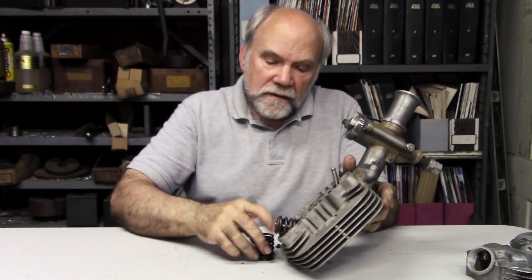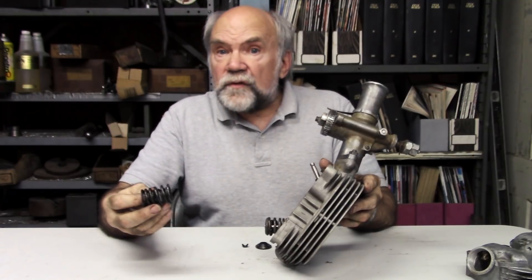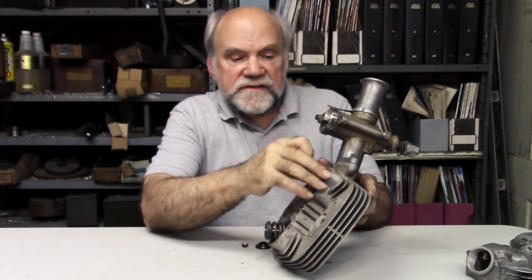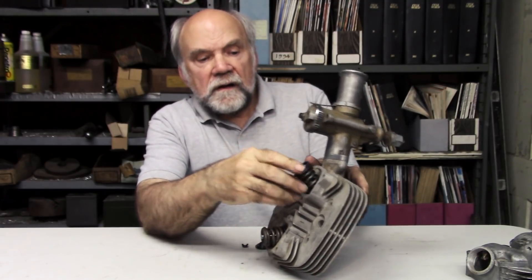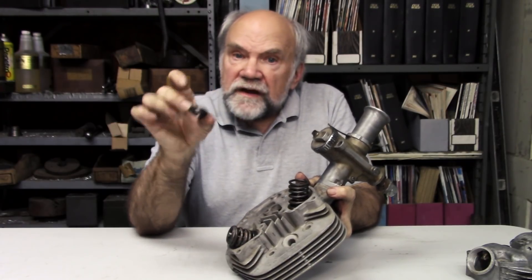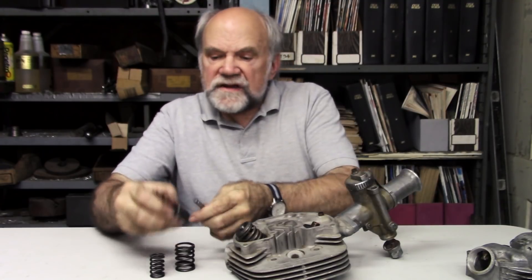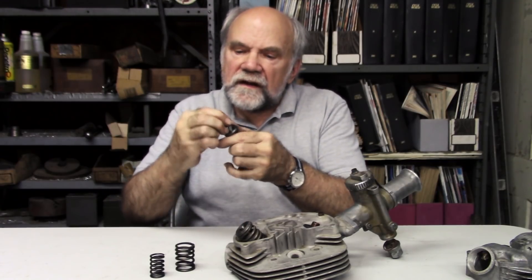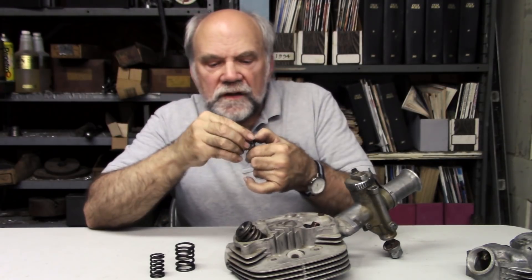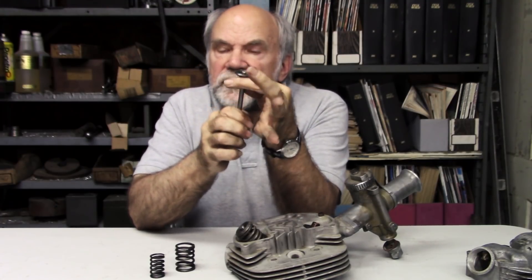The valve is held closed by springs. In many engines there is only one spring; in quite a few, there are duplex springs. They sit on a steel washer. A valve spring compressor, which is like a glorified C-clamp, presses the spring down with the spring retainer on top of it, until the valve stem sticks through the retainer far enough that you can reach in and put these little collets — they're tapered, semi-circular — into the groove on the stem, and then let the retainer come back against them, locking the spring retainer to the valve stem.